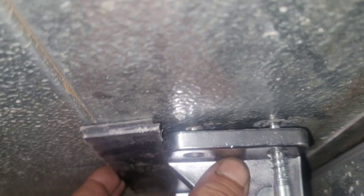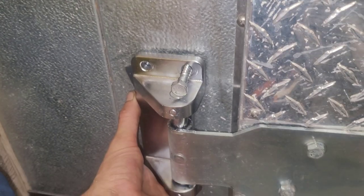Something important to notice is that these old ones were shimmed with two shims each, but two is too thick. I believe these are the same offset, so I'm putting one back in each one because two was pushing it out too much. Watch out for that.